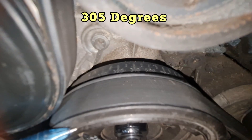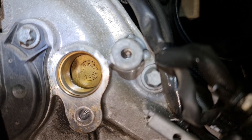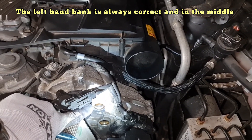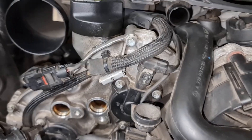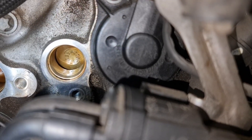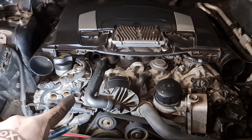Once you set the crankshaft at 305 degrees, in the camshaft position sensor hole, the circle marking — which is part of the cam — should be exactly in the middle of the hole. That's the left-hand bank intake camshaft in correct position. Then check the right-hand bank camshaft position sensor hole: without changing the crankshaft pulley position, that marking should also sit in the middle. As you can see here, it's not exactly in the middle, but after 200,000 kilometers the cam chain will have some slack — this amount may still be acceptable.